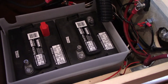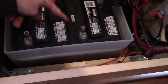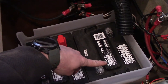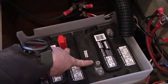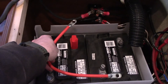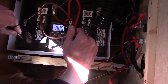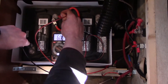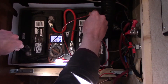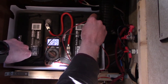When you're converting to six-volt batteries, you want them connected in series, which means the voltages add together. If you were connecting two 12-volt batteries in parallel, you'd tie the negatives together and the positives together. But since we want to make 12 volts from these six-volt batteries, we connect the negative to the positive on one of the batteries. Then you get 12 volts at your positive and negative connection. We'll use a jumper wire meant for this to connect the negative to the positive, giving us 12 volts out of the whole system. Each battery is about 6.04 volts, and together you get your 12-volt battery.